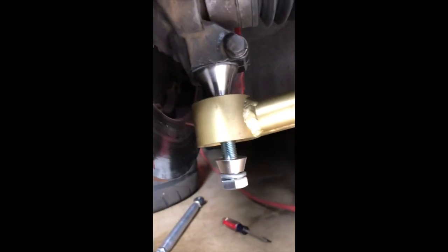I just found it works easier when you're trying to bolt it to the sway bar. Put this onto the shank for the ball joint replacement — just got that in loose. Also worked this in. Whiteline makes these end link shanks super long for the stud, which makes it kind of a pain, so it's easier to do the control arm first. Now I'm just lining up this, and the nice thing is you've still got plenty of play so you can get all three of those lined up and finger tight before you start on the rear.